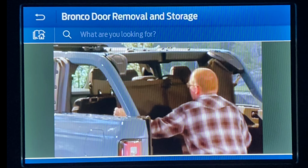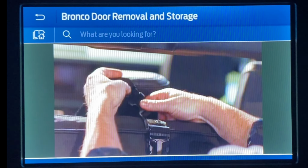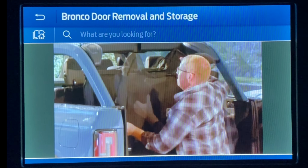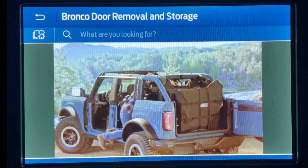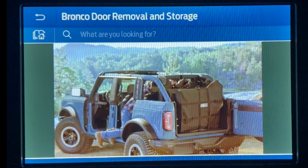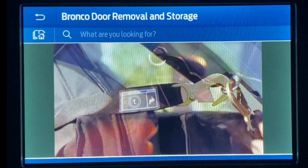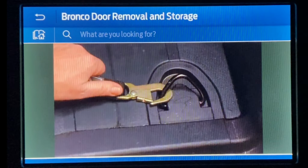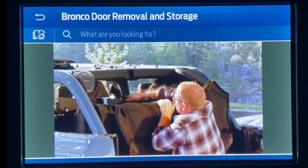Align the door peak with the highest point in the upper trim and then secure the bag by clipping to the retention harness. Now, follow the same steps for each door in order, clipping each as you go. Lift the retention harness over the doors and straighten the straps. Secure straps 5 and 6 to the upper eye bolts and secure straps 7 and 8 to the lower rear cargo rings. Tighten all adjustable straps.